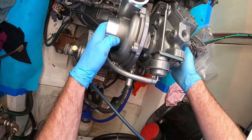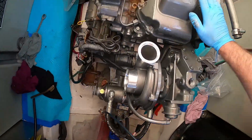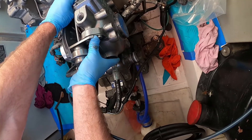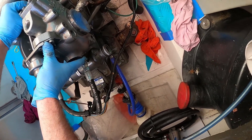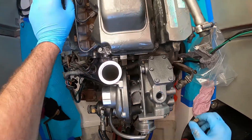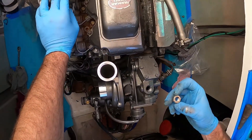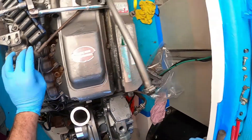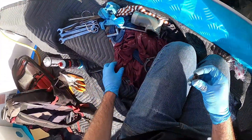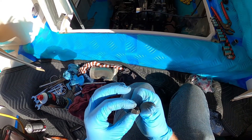It's not light. So now that we've got that, the first bolt you have to do is this one, because as the turbo goes on you can't get this bolt on - I'm sorry you can't see it, but I can't see it either. I'll get this one on just a hair so the turbo doesn't fall off. Okay, that one's on. Then we've got this one which is all black, so I'm going to clean this up much better.